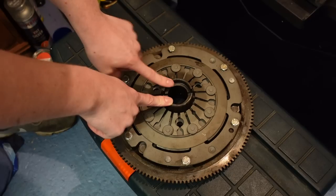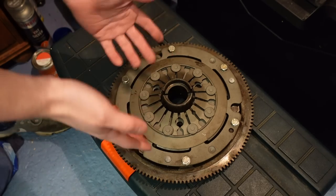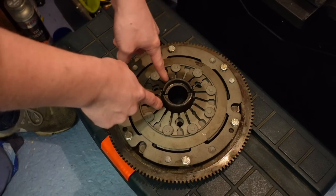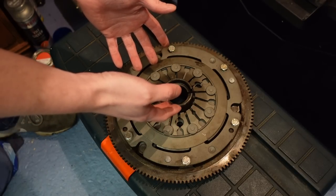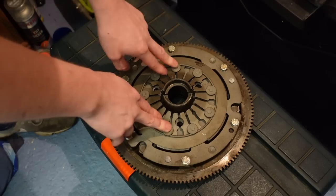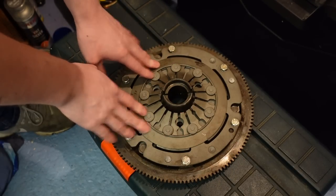You can still get these, but you can't get the bolts - at least I couldn't find the spec for the bolts to buy them, not specialised for a mini or a metro. What we need to do is make sure the clutch is perfectly centred, or more so that it's loose within the housing. I need to loosen off the pressure plate ever so slightly to loosen the clutch to be able to slide it over the crankshaft properly, get it engaged, then tighten these back up, put the big bolts in the middle, tighten it up, put the cover on, and everything on the engine will be done.